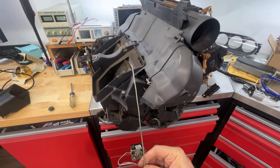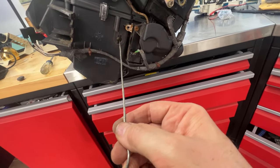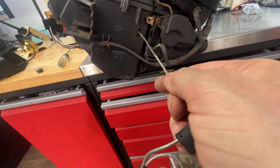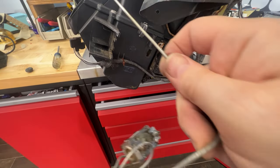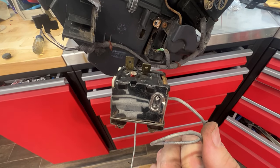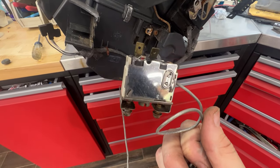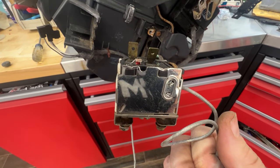It's pretty long — probably nine or ten inches — and it does seem to go back in. I did check this electronically and the two electrical connectors right there do have continuity when it's sitting out in the shop like this. I tried putting the capillary in a glass of ice water and it did not open the circuit, and I think that's just because it didn't get cold enough.